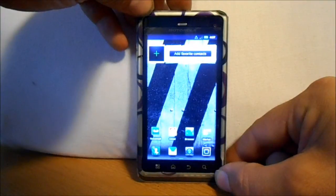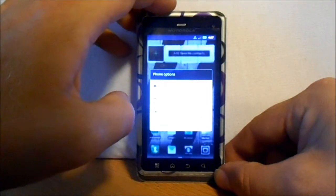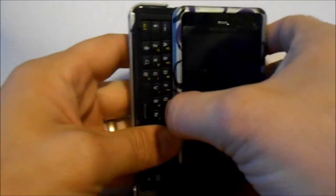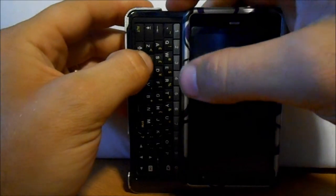To update it manually, we have to power off the phone. Power off, shut down. Slide open the keyboard, push the X button, and hold the power button.